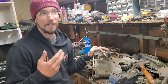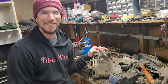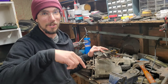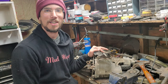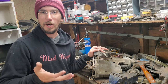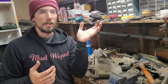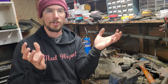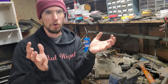I unloaded it. I wanted to see how fast it would go with me on it, drove it down the driveway and it did really good. I turned around at the neighbor's, got a little overzealous on the second hit, and I'm pretty sure we ate the pump right out of it. Keep in mind that transmission was also used for the experiment of running an eight-inch drive pulley on the engine to the stock pulley on the transmission, so I had already been running it at a two-to-one ratio for a little over a year.